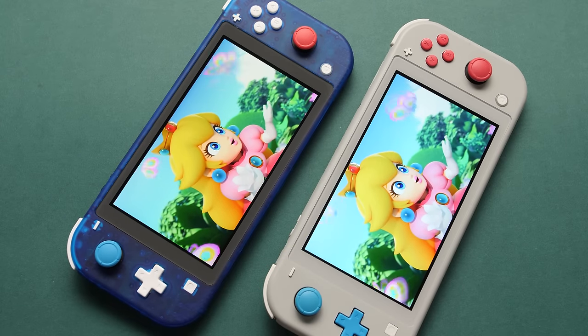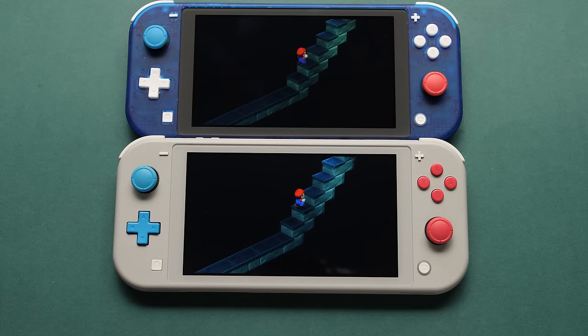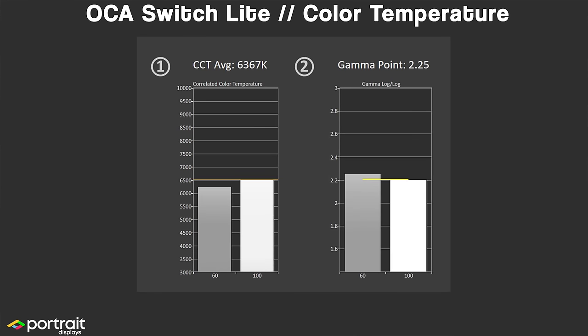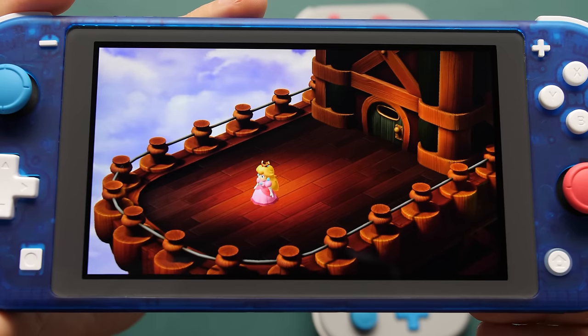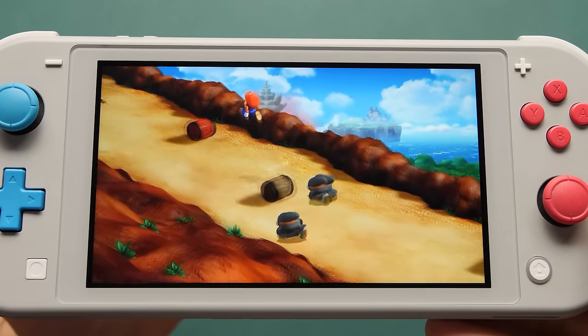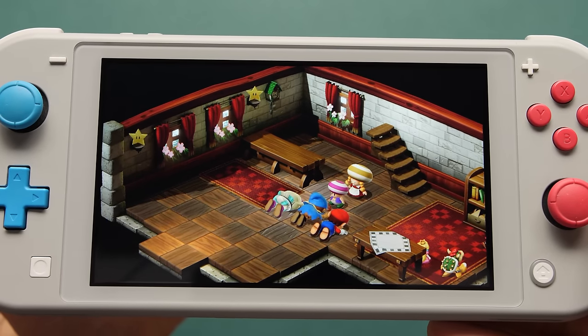Here are the benchmark results. I am shocked by how accurate the stock screen is — it has nearly 100% sRGB coverage, and most of the color bands are under a delta E of 2, meaning they are properly calibrated. The RGB balance is a bit off with whites appearing more greenish-blue, but peak brightness is good at 400 nits. The replacement screen has a lower peak brightness of 268 nits, but more accurate colors for everything except blue and green. Both screens have trash contrast ratios — this abysmal contrast ratio is why darker games do not look good on the Switch Lite, and it's why there's such a big difference between the stock screen and an OLED replacement.